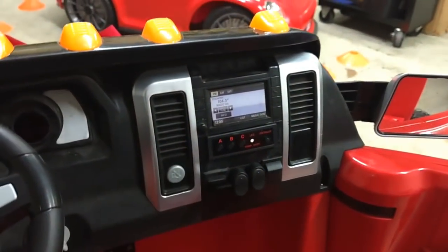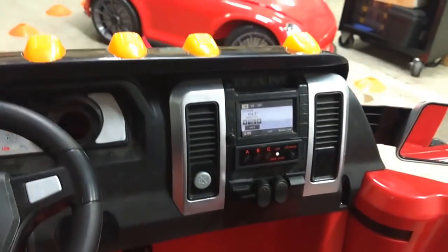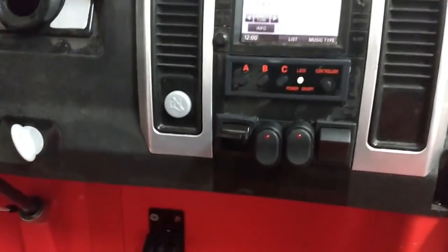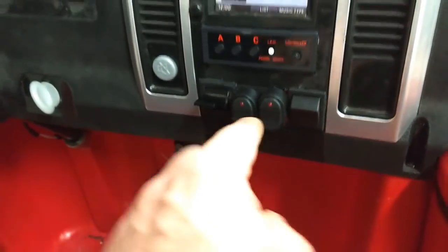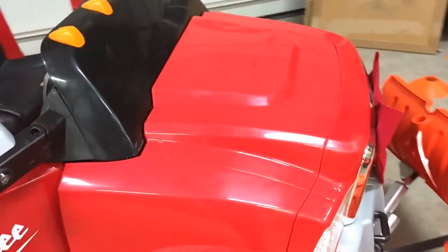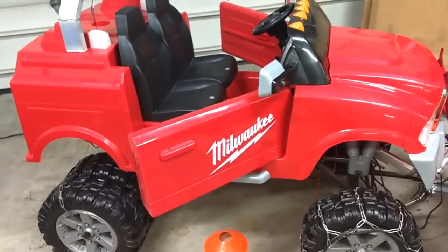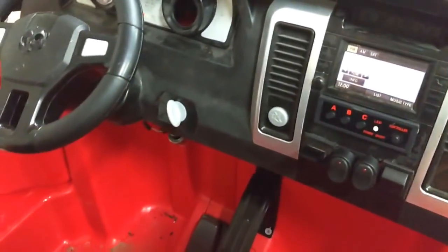This is a stock location where the battery indicator LEDs were — you pushed a little button and it lit up green, yellow, red depending on if it was dying. So that's in the dash now. We've also added the headlight rocker switches here. This one's not done yet — it's going to be for the cab light running lights, and we're going to do some amber LEDs in the headlight buckets. We're trying to keep this as realistic as possible, we're not going to do underglows or anything crazy like that, but the strobe lights turned out pretty bitchin.